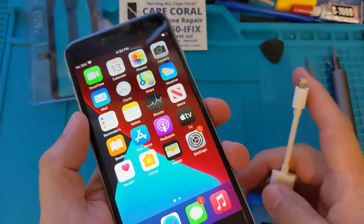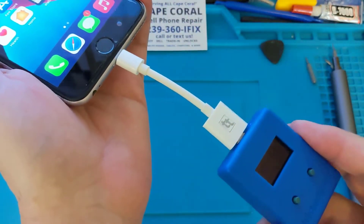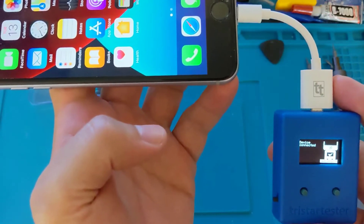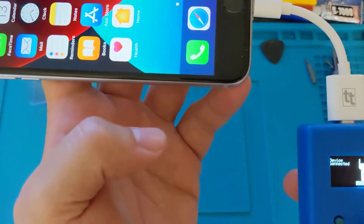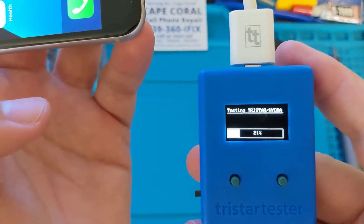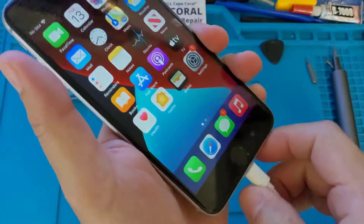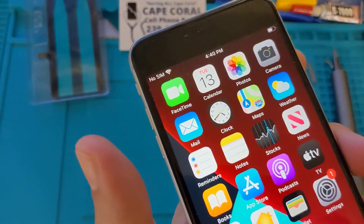When a phone is brought in suspected of needing the battery replaced, we put in the TriStar tester — because sometimes it may not be the battery; it could very easily be the IC chip, the TriStar chip, or the Hydra chip. We do a quick test, and it passed, so the Hydra chip is fine. We are now going to go ahead and replace the battery.